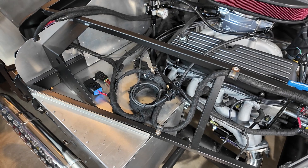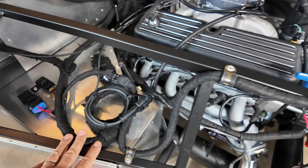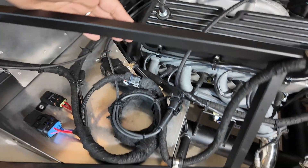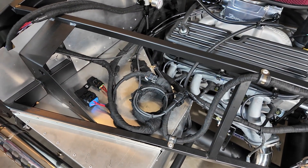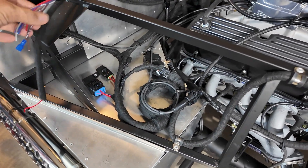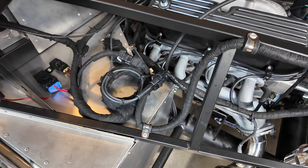Once the final wire was fitted to the radiator fan, all that remained was tidying up the harness. I coiled it as best I could, put some fire-resistant tape on it, secured the two relays, and made sure everything is secure with nothing pressing close to the engine while still keeping access to the cables. Overall it's not the most attractive thing, but most of it will be covered by the body and it looks fine.